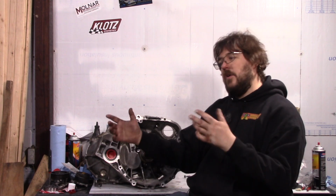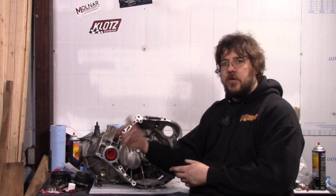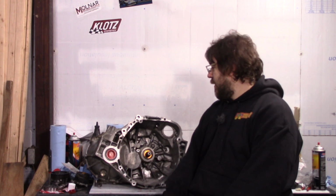So if you're looking for the absolute best fuel economy you can get on the highway, but you're also looking for a fun toy with better gearing, perhaps the best option is to use the EB60 and then just buy the EB62's 6th gears and swap those in. Now, that ends up making for a bit of an expensive transmission. The truth is, whichever one you get is good enough.